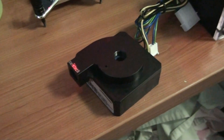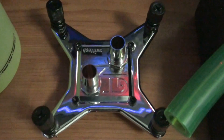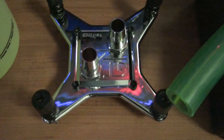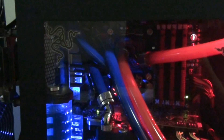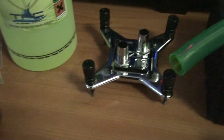This is a great pump — it's silent, high performance, and it'll fit anywhere. There are some bigger pumps that are a bit faster and stronger but also a bit louder. Now, water blocks are another thing you need. Whichever components you're going to be water cooling, you need a water block for. The components you can water cool are CPU, graphics cards, motherboard, hard drives, and RAM. The most important place to start is the CPU, then graphics cards, then the motherboard, then memory, and last of all the hard drive. That's in order of importance, because you'll get the most performance increase from overclocking the CPU, and the cooler your components are, the further you can overclock them.